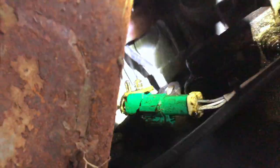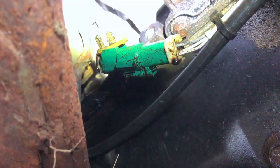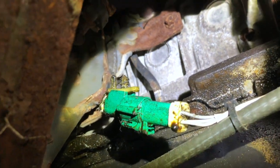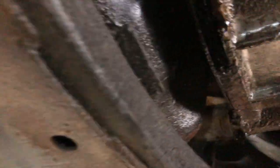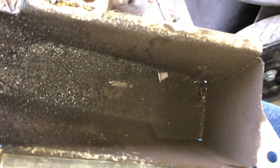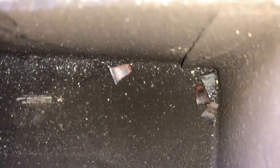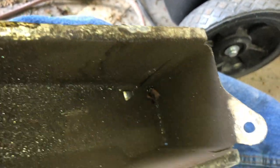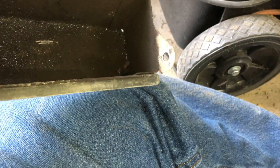Look at that. It's a fancy aluminum block up in there. At least that's what it looks like. I didn't know these came with aluminum blocks, to tell you the truth. But that looks pretty aluminum. Man, this setup would be real nice in a Fox body. Well, we got that dust cover off, and I don't think there should be chunkies in there. I think those are off the pressure plate. That's my guess. Definitely going to order up a clutch kit tonight, because that don't look happy.